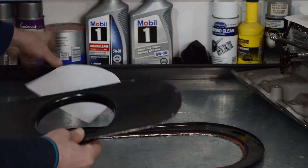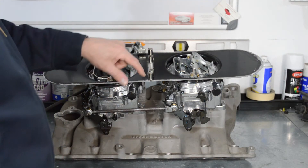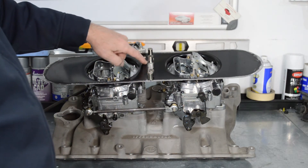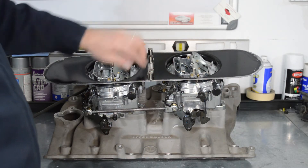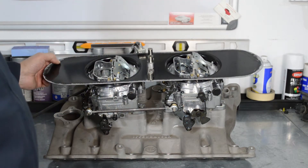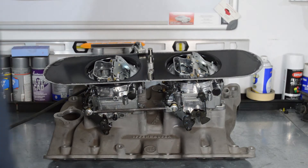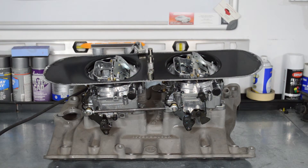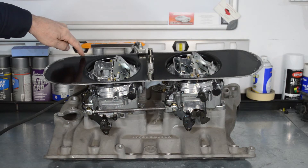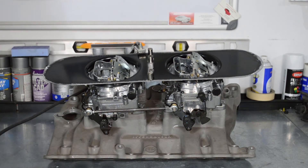Both sides are cut out. I took the two best sides finish-wise and cut the other side about in the center so they butt up nice and smooth. Got them held in place with some magnets, got my ground strap on. Any day you can weld is kind of a good day - we'll break out the big metal glue gun. I'm going to tack these pieces in place, then put up the base and mark because I'm going to have to trim some more off to make it fit and have it flush all the way around.